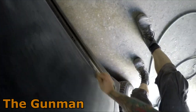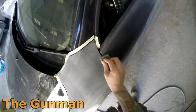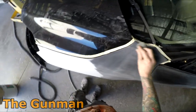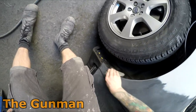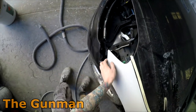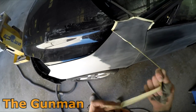So what I've been doing these days is actually going 800 and then just Scotch-Brite for those little nooks and crannies that are a little bit trickier to sand with the 800 grit. It just speeds the procedure up a little bit. And look, sometimes if I'm just in a real hurry, I will actually skip the 800 grit stage by hand, and I'll just go straight to grey Scotch-Brite. Just be careful when you're doing the grey Scotch-Brite that you keep that piece of scotchy clean.